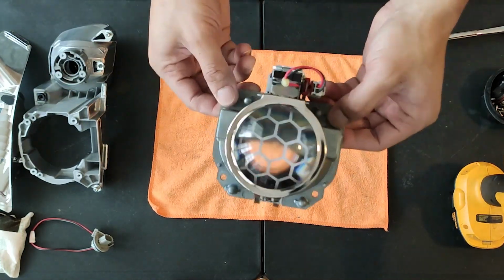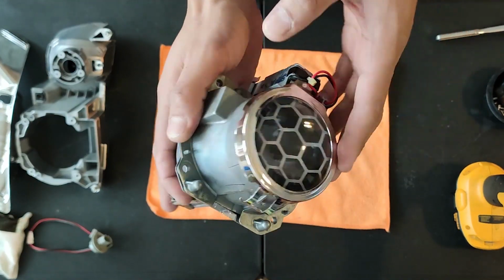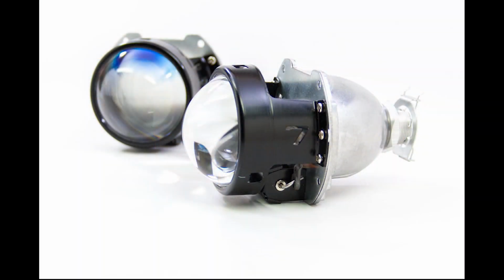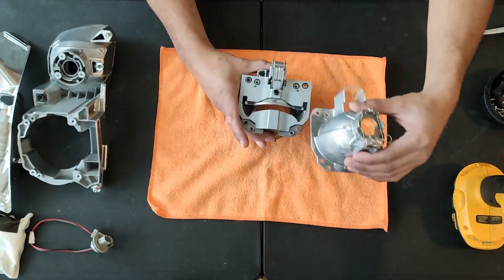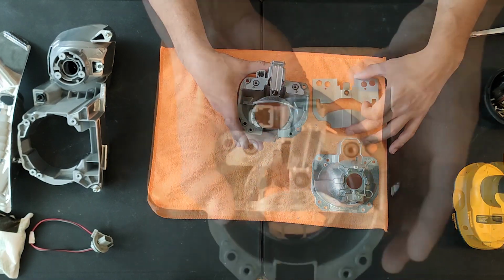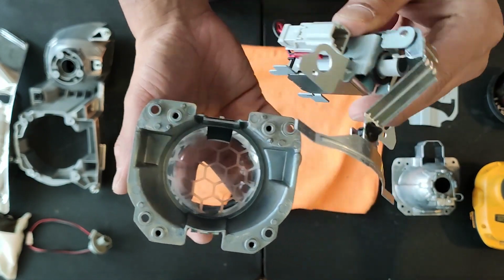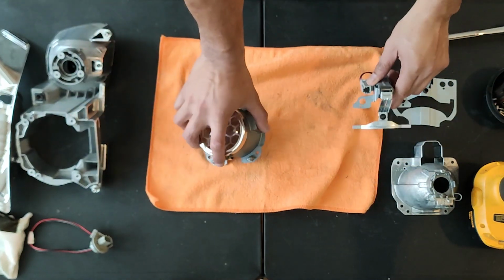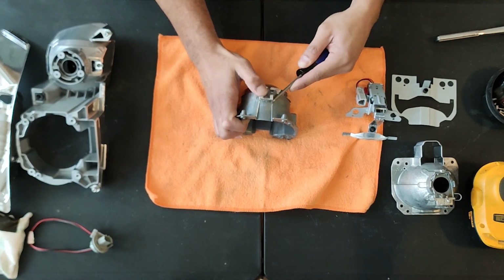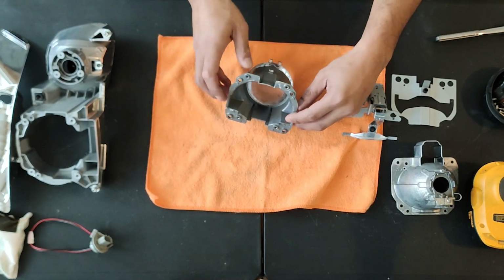If you didn't watch my last video, I showed you guys how I etched my projector lens. If you're interested, I'll leave a link down below in the description box. Taking a look at it, it's a little different than most modern projector assemblies. The rear cover just pops off along with the bracket. Let's remove this metal cutoff shield. And then the clips that hold on the projector lens. Use a flathead or Phillips to pry it open, and we can now fully disassemble the whole projector assembly.